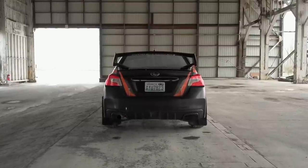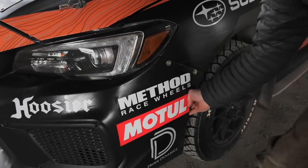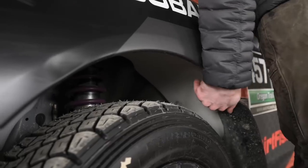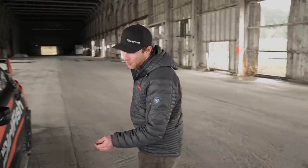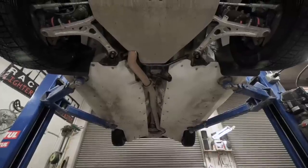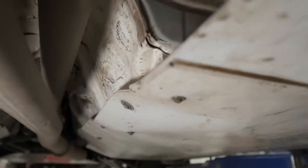Next are some body pieces and body protection. We mount our bumpers differently — OE clips just don't do it, so we make a mounting structure that the bumpers bolt to, making it super strong and rugged so you can't rip the bumper off. Inside the wheel well, you can see our custom fender liners, which are much stronger than OE plastic and won't rip out when you hit a water crossing. Per rally rules, you have to have mud flaps on all driven wheels, so you can see our custom mud flaps and mounting structure. Moving further back is our underbody — it's HDPE plastic on a mounting structure underneath, so we can swap it out every couple of rallies when it gets worn. The plastic is inexpensive, making it a great tool to protect the bottom of the car.